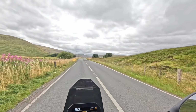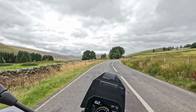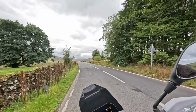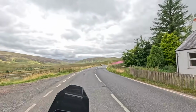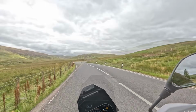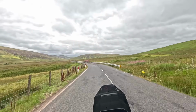The easy ride clutch, it's good. Much better than expected. Easy to get used to, plenty of engine braking available. It'll be excellent for any novice trying off-road because it won't stall. More experienced riders will probably prefer a conventional clutch setup, however. The ERC elephant in the room is, when parked in gear, the clutch is disengaged, so the bike can and will roll away given a sufficient incline. In my opinion, the system needs a quick access parking brake.